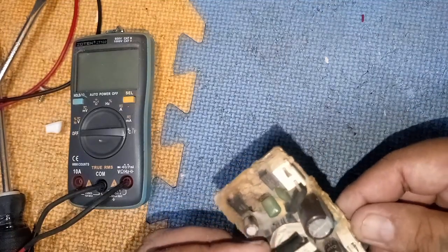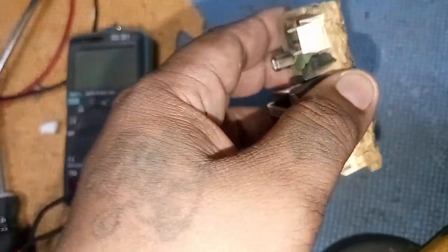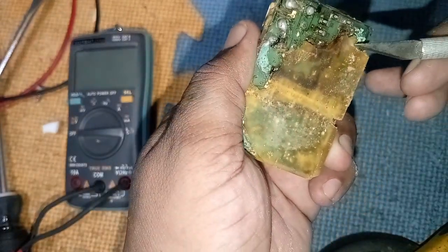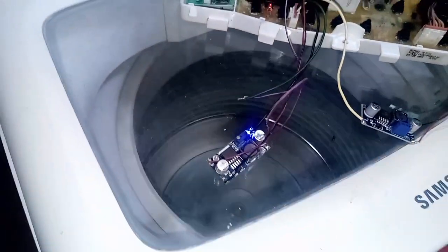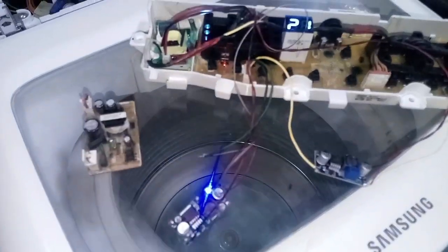Visual check the board. Remove all the silicone and continue checking the board. I already replaced the power supply board with an AC to 9 volt power supply — because I don't have a 12 volt and 5 volt dual output power supply. I used a boost converter module for 12 volts and a buck converter module for 5 volts. This original power supply was hopeless. The Samsung Wobble automatic washing machine is working perfectly now.